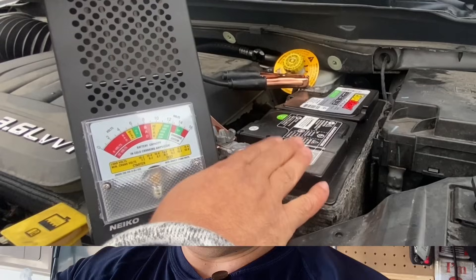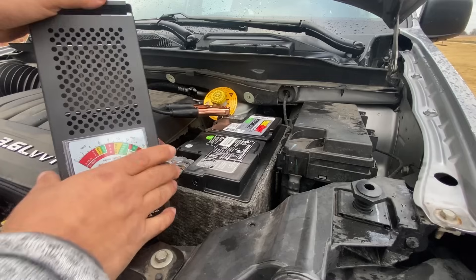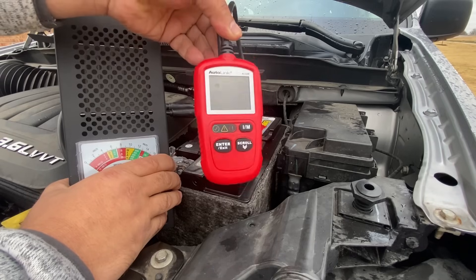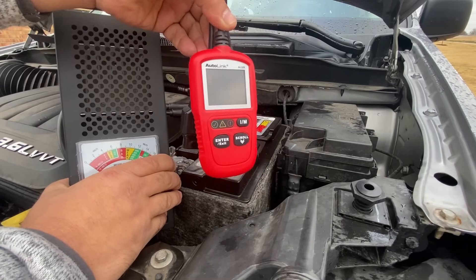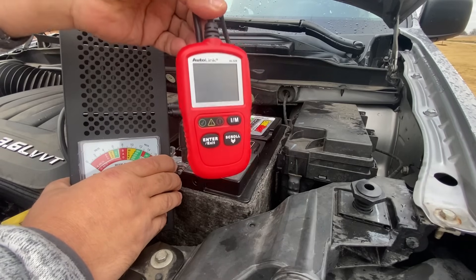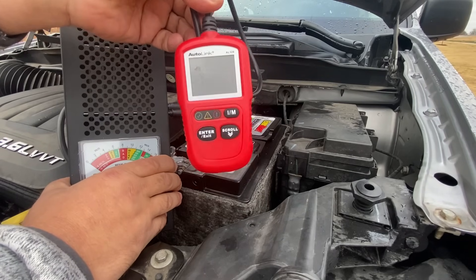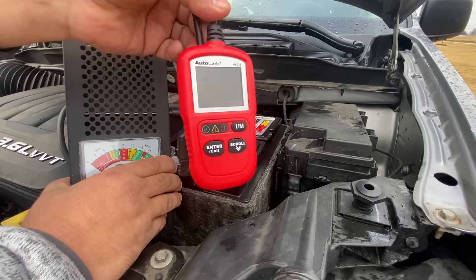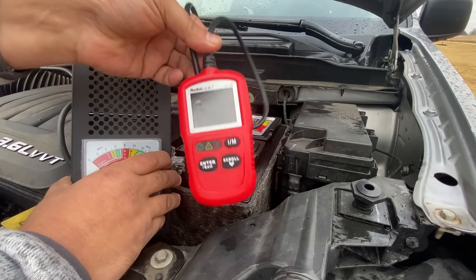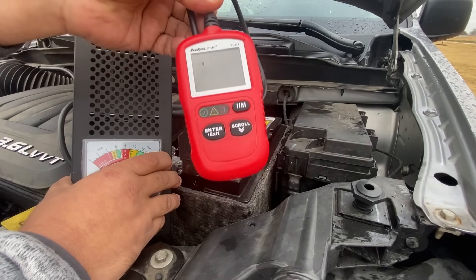There's really no disadvantage to putting a new battery in the vehicle — it's going to help you figure out exactly what's wrong. This, along with a simple $30 OBD2 reader, is a must for me. I don't generally recommend OBD2 readers, but if you want one, this is it. For under $30 it makes drive cycles so easy — it auto-refreshes and beeps to let you know when a monitor is not yet complete.